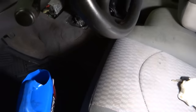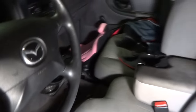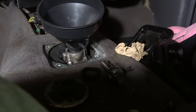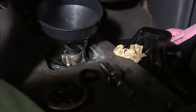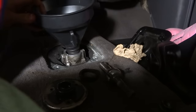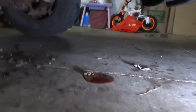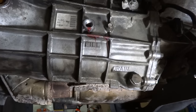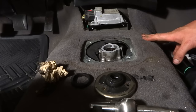I went underneath the vehicle and cracked the fill bolt — you don't want to crack the drain bolt, you want the fill bolt. Pour the transmission fluid right down in here. It's Mercon 5 — I just put it in this container. Mercon 5 is what you're going to need. Put your funnel down in there and pour it right in. This is what you're looking for: you've got it on the ground and you want it to drip just like that. When it stops dripping, put the plug back in and you're done.